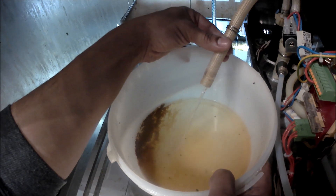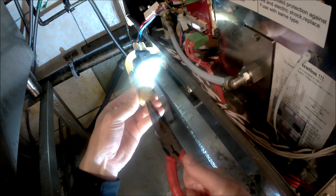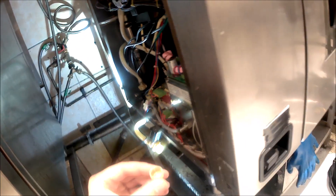We're going to test this solenoid to see what the issue is — there is little to no flow here. We do have two inlet water screens, and we want to check them to make sure they are not plugged. This thing should be filling the bucket very quickly. We take the screen out and someone has put the screen upside down so you can't even grab the tab with your pliers. The tab should be facing downwards. That one's a little bit dirty but we'll get it cleaned out. Here's the screen in the solenoid — we'll pull that one out as well. Make sure you're putting in those screens in the correct orientation. Not super dirty, but let's get everything cleaned out and reassemble.